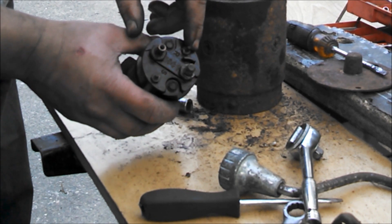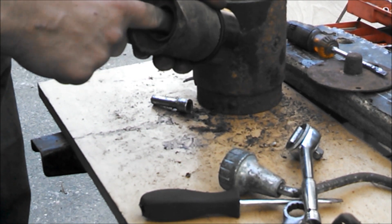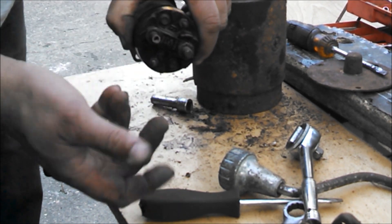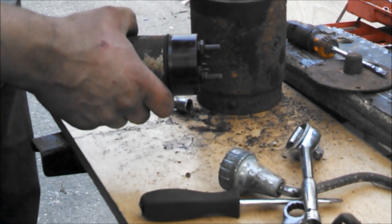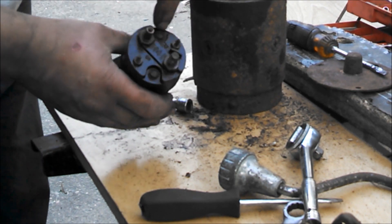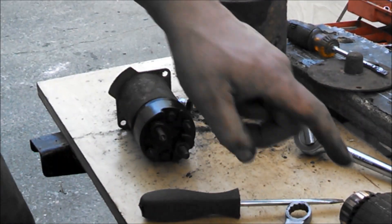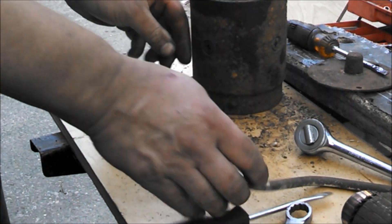What happens with these — if you ever get that click-click, this thing is energizing, it is pulling the plunger in, it's hitting the pin. But the contacts are corroded, or they've been arced so much that they don't work right. You don't get any current and the motor doesn't spin. And then you bang on it and it gets loosened up and it starts to work again. What we're going to do is open this up to get to those contacts, because we did have that clicking but no spinning. It also could be the brushes that would cause it not to spin, but we'll try to get this open.